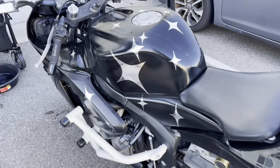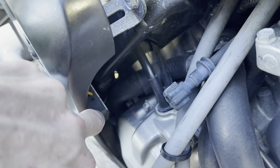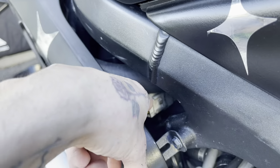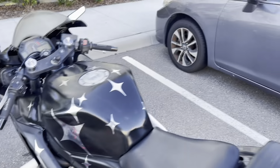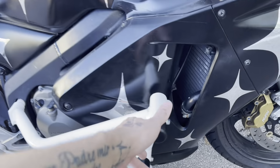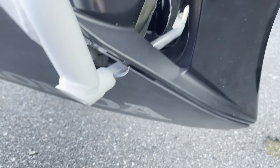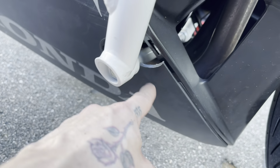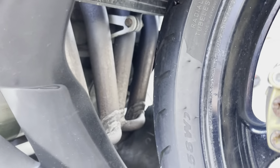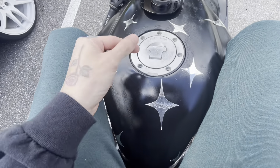The bike is finished. Put everything back together, pucks are on. I relocated the stator right in there — nothing's moving. Stator plug moved to the other side, same thing on this side, everything's tightened down. We have the under brace — I did have to drill more holes for the under brace to go through on both sides.